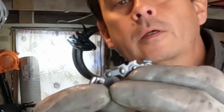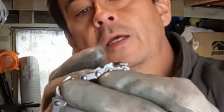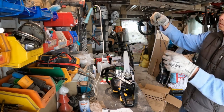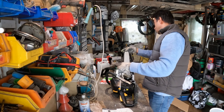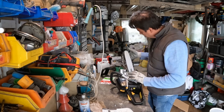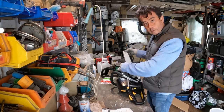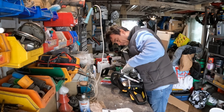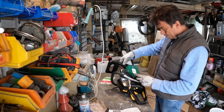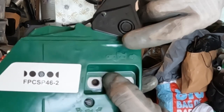The cutting tooth is this one here, facing the back, so that as it goes around in this direction it cuts. Let's make sure it's on the little cog at the back there, and then pull it tight — not too tight, but enough for it to sit in the slot on the chainsaw guide, like so. Put the cover back on. There's a picture there showing the direction of the chain, so it's got to be in that orientation.